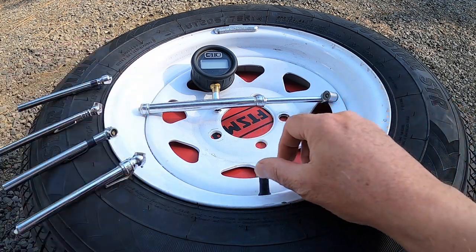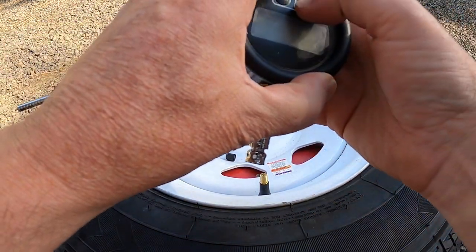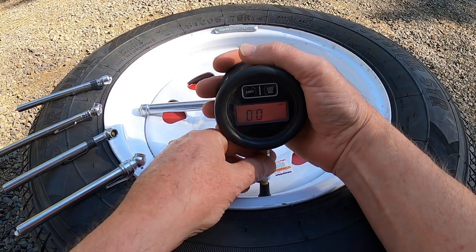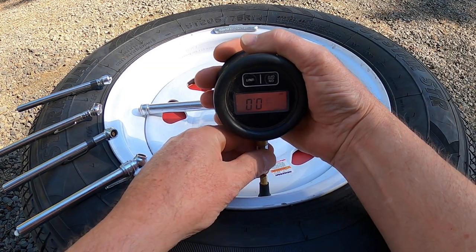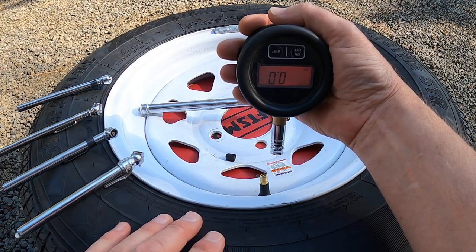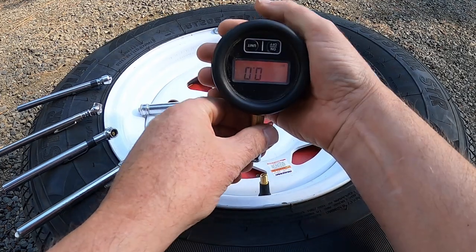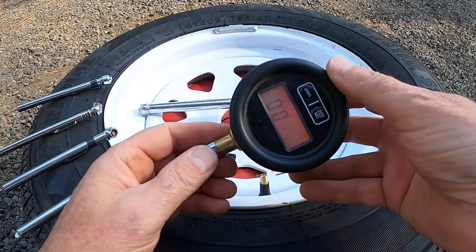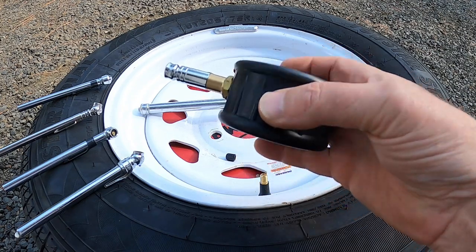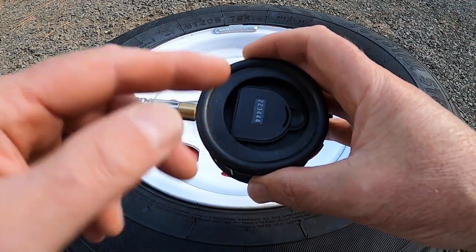Some of these are very inaccurate. So let's take this — I just filled my tire up. This tire is 50 PSI. This is a digital gauge and I've calibrated it and I trust it. I'm at 50.9. I brought that up just a little bit so that as we go through this test and this tire loses a little bit of pressure each time I push it on, it'll still be very close to 50. A second time: 50.9.